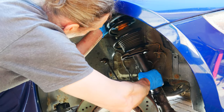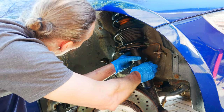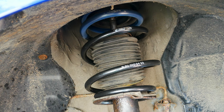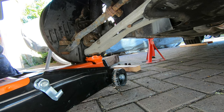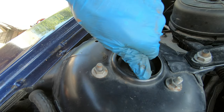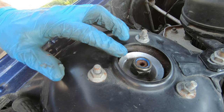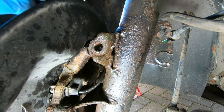That's ready to go. The easiest way to get this strut back in is to lift it up into the top mount, and it's best to feed it in from the front of the hub because there's wires at the back that get in the way. Now it's just a case of jacking it up until you can see enough of the shaft coming through at the top that you can get the nut on. As soon as you're able to, it's worth getting that top nut on because that means the strut won't fall back. It should be possible to get this bolt in that we removed earlier.